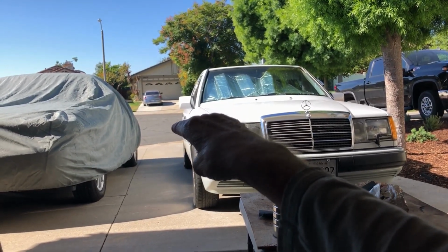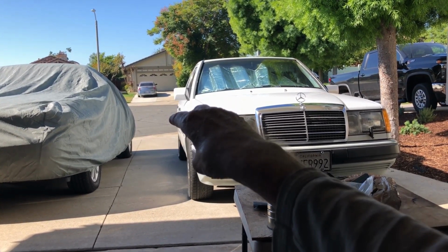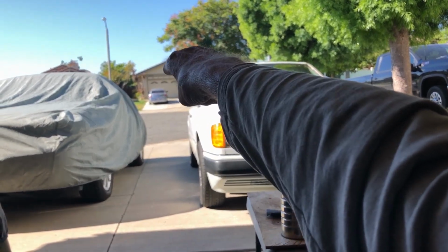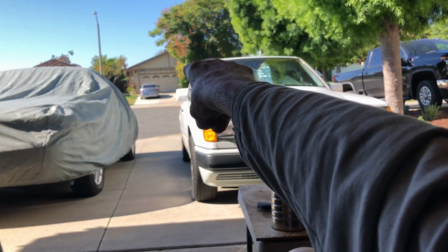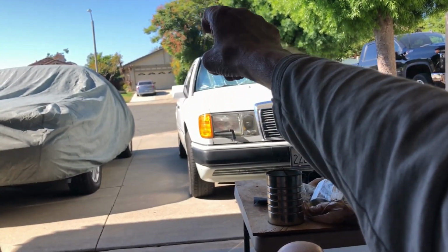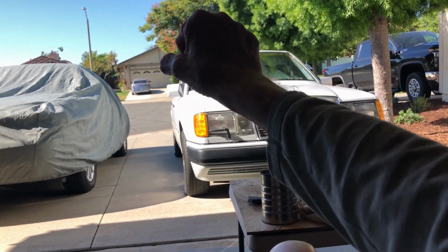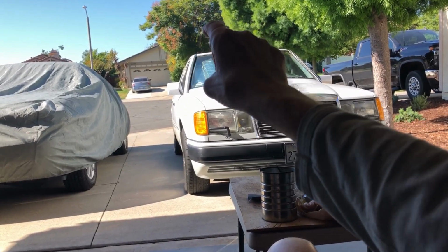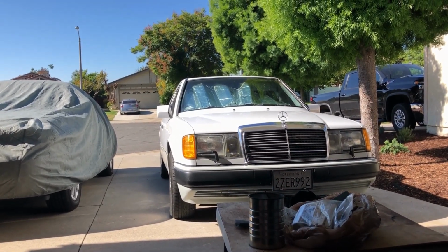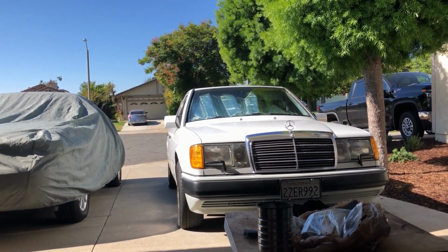You need to lift all those pins or whatever they are, and move them all down one notch. Because this one has two slots in the electrical connector that were empty, pin 1 and 2, and it's supposed to be pin 13 and 14 that are empty. So I was going, well, we don't know. I don't think it left the factory like that. I think somebody rearranged things on me.